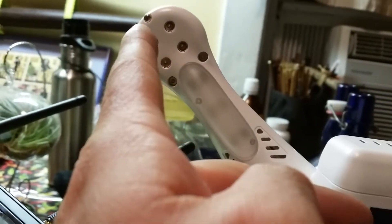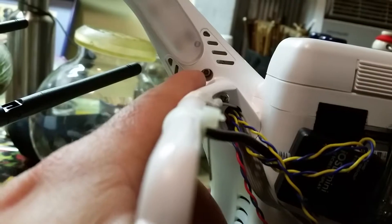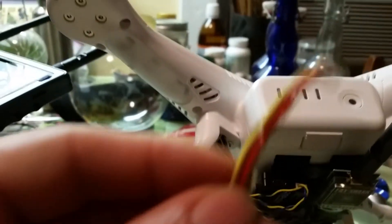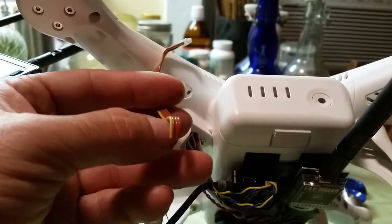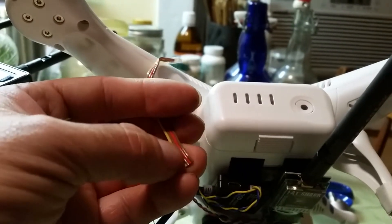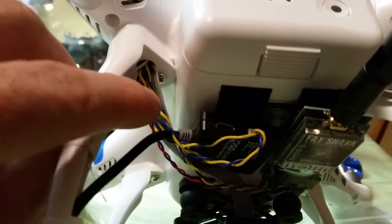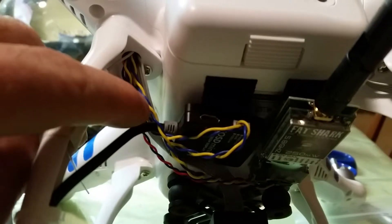This is the very top screw here — you unscrew this and you unscrew these two; you leave these four alone as they're for the motor. You take up the lid and unplug. This is the wire you would find normally. The yellow is your video out, the browns are both grounds, and the red is your hotline. For the plug-and-play cable you have the same thing: red and blue for hotline and ground, yellow for video out. I think it's like five volts — don't quote me on that.